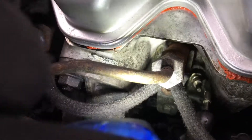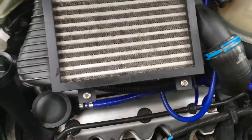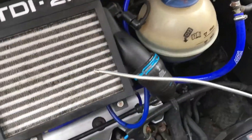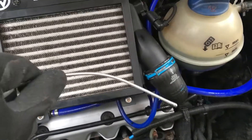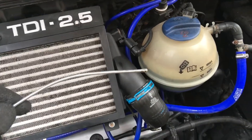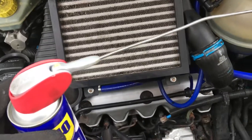What I've done is prepped them. Yesterday I located them, found the WD-40 and squirted it all around them, then drove it around today to get it hot again. Came back with a hot engine, put the gloves on, and sprayed them with WD-40 again. I went down to Eurocar Parts and found this amazing WD-40 can with a directable nozzle — it doesn't fall off and it can move anywhere. So I've just gone around again with that and soaked them again.